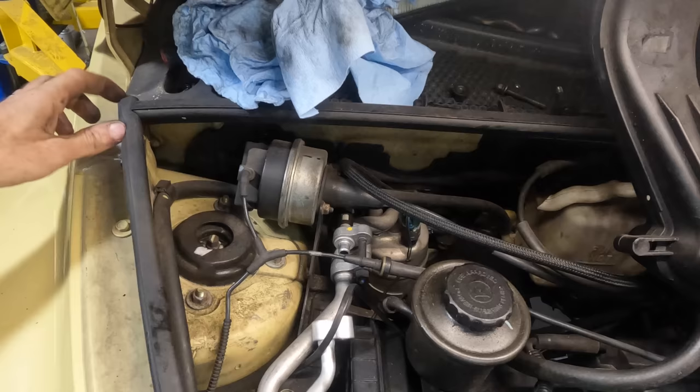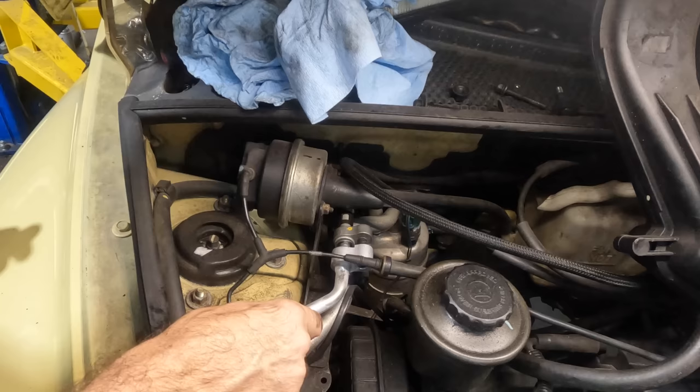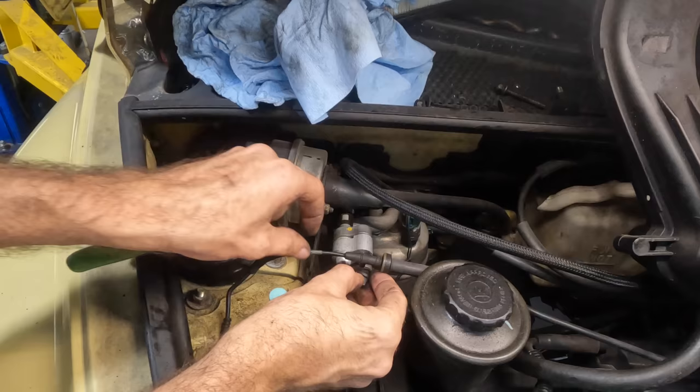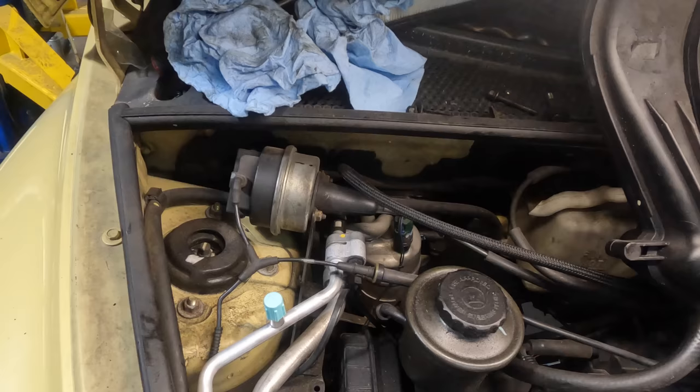Okay. There is a new gasket that goes right there on that flange face. It is a rubber impregnated metal gasket. Stick that right there. Small click. Doing that is actually less stressful on the components than trying to manually apply torque, because I'm not actually putting any twist to it. But if you overdo it, you're gonna be in a world of hurt.